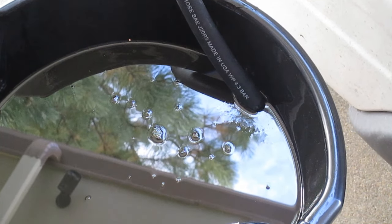Alright, so I went ahead and tightened this fitting up off camera, so you don't have to watch me fiddle with a stubby wrench here doing an eighth of a turn at a time. But it's on there tight now. This one's torqued down to spec. So now all we have to do is remove the hose that we attached earlier and the plug from the reservoir. Hook that line back up to the reservoir, fill it, and then we'll make sure the system is bled out and not making any awful noises or anything like that, and go for a test drive.